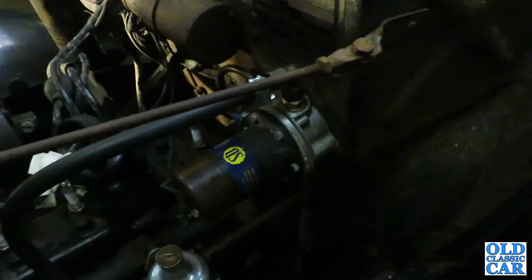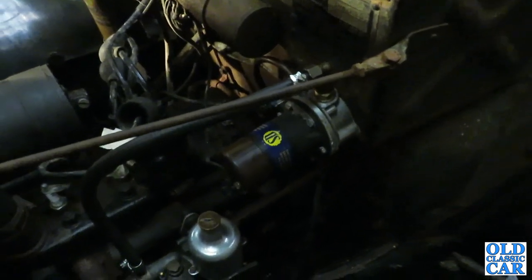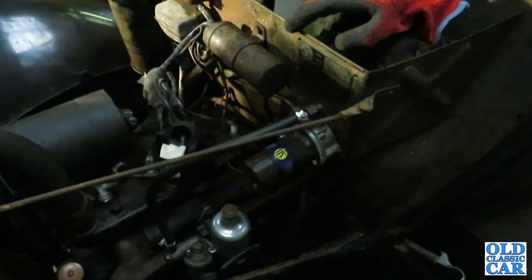I got my airline out and blew through from the front to the back, so the pipe is clear. The pump is now working — when you turn the ignition on it chunners into life, and it's now plumbed in with the right hosing and some better jubilee-type clips, because previously it had some horrible crimped-on things. Hopefully the jubilee clips will tone down a little bit — they're a little bit shiny for the rest of it, but not to worry. Next thing is to put some fuel in the tank and check whether it'll actually pump up.